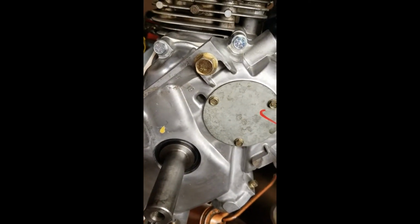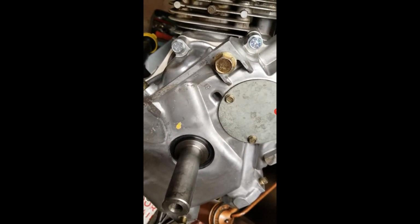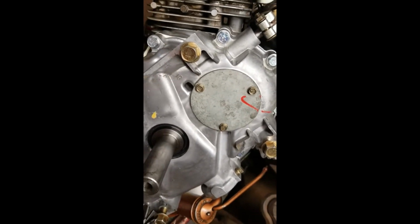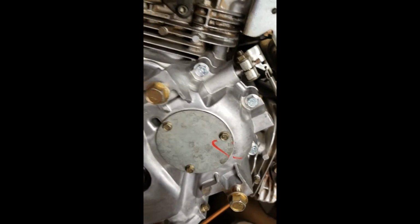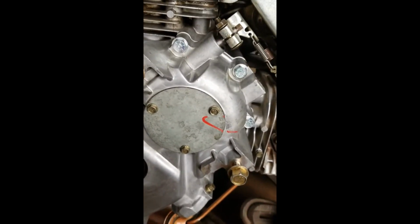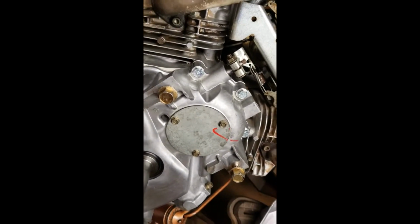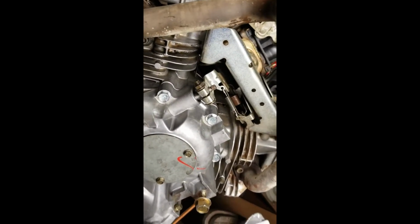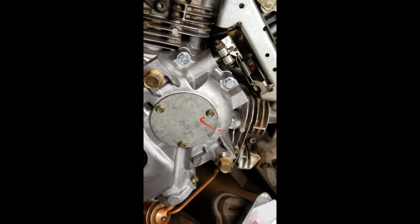And again, we found a bad alternator before. We got the brand new alternator, so we'll put that back in. We'll flip this motor over and get it on a pseudo stand, wood blocks, and finish up the front of the motor, put all the shields back on. Yeah, they went in the parts cleaner too. I'll put the flywheel back on after we get the alternator in, and then put it back in the tractor and fire it up. I've also got the tune-up kit, so you know, it'll get new plugs, fresh oil, all of that crap.